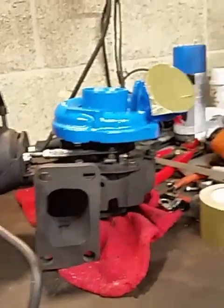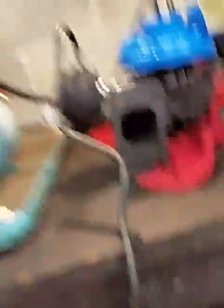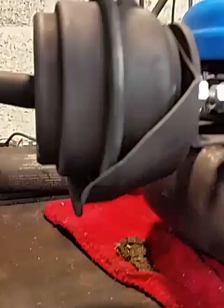But that's only half the equation — how do you control it from here? The part of the variable nozzle is you're able to regulate this still with a boost controller through this side. I'm going to set this here so I can use my air nozzle. So you just put a little pressure on it. The boost pressure — the vanes are closed, the turbo's spooling up, the boost gets to where it needs to be, and the vanes start opening up. You can see it's very, very responsive to the boost pressure and it will hold that. You hear a little bit of a leak — that's okay, we don't want the diaphragm inside the gate to blow.